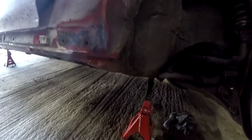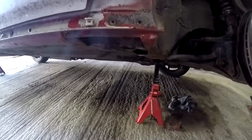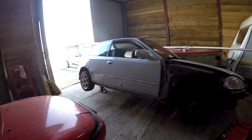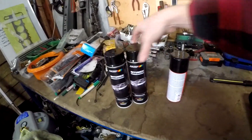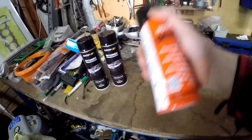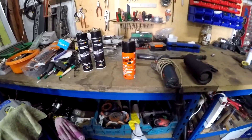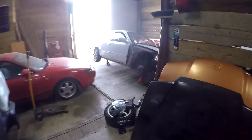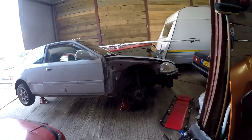Then it's the rear areas that are bad. But the best thing is this is perfect practice for me - the fender covers this up, a side skirt goes here and covers this up, so you're not going to see any of it. It doesn't have to be the prettiest, it just needs to function. If I prep it well and put a little extra attention into the steps in between, we should be all good. I have some undercoating for the car but that's the last stage. For now I'm just going to take an angle grinder with a flappy disc and a wire wheel, scuff up the bottom side, get all the rust off, make it as clean as possible, spray the rust converter on - and that's my job for today.